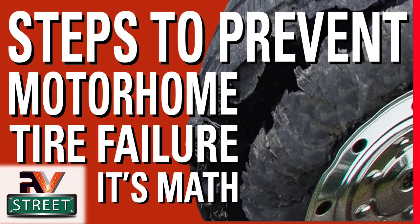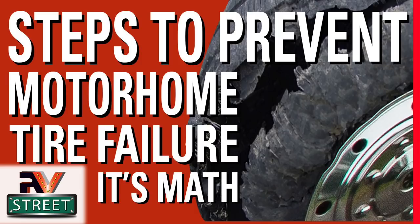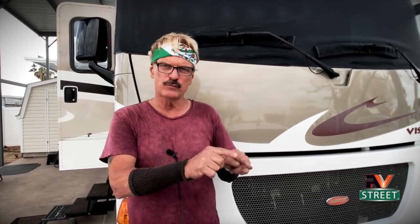In addition to these bolt-on DIY chassis upgrades, we all need to look at weight distribution, having your tires balanced, and air pressure. You really have to watch your air pressure — and the only way to know what air pressure to use is to weigh your coach and then inflate your tires to the proper PSI according to the tire manufacturer's charts. I'll put a link in the description about that. It's not any one thing, but all these different upgrades working together — watching my weight, watching my air pressure, and listening to my coach to know what needed to be done.